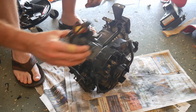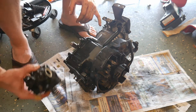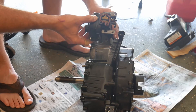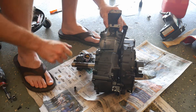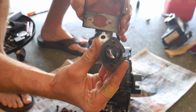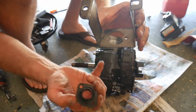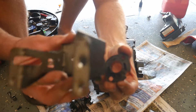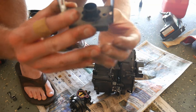The good news about this carburetor is that relocating it is going to be really easy — it's just got this one circular O-ring that it attaches to. Normally the carburetor sits in this configuration, but we obviously need to turn it to suit our horizontal shaft, so we want to twist it 90 degrees and remount it. Rather than notch out the metal, I'm going to notch out the plastic on either side so it sits this way and just slides down over there.